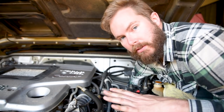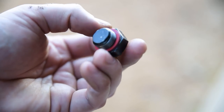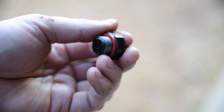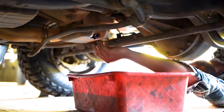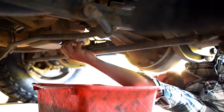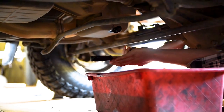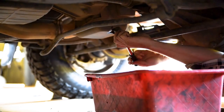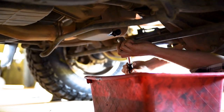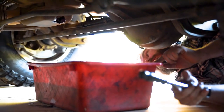Two more steps to go: put a new washer on the sump plug and put that back in, then fill it up with oil. There's our sump plug — it's got two stacked fibre washers on it now; it had a copper washer on it before. That is ready to go back in the sump. You want to be pretty careful not to drop it in the oil. Finger tight — it's not the Challenger spaceship, it's not going to blow up if you don't do it up tight enough. There's probably a torque specification for that, but we're backyard mechanics, not legit mechanics — we'll get away without it.